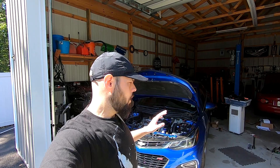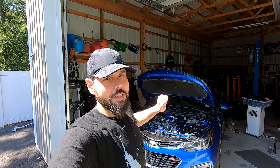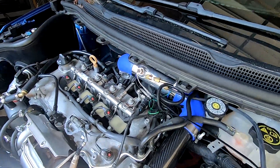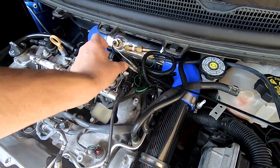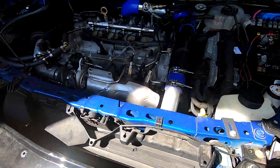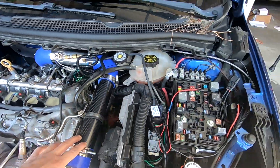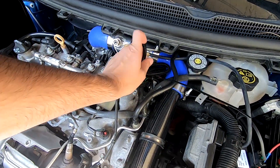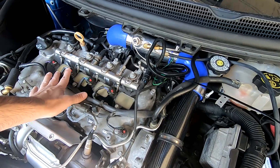Hey everyone, we're just jumping into this video. All I want to do today is show you basically how I have everything at this point. We're going to take the car for a drive so we can see the methanol working, and then eventually I want to get it to the dyno. Off camera I decided to just finish up some things, so the temperature probes are set up. The wiring is sent to both of the probes — one in the intercooler, one in the intercooler pipe. I have the wire for the shift light just sitting here because I haven't quite figured out how I want to wire it into the coil.